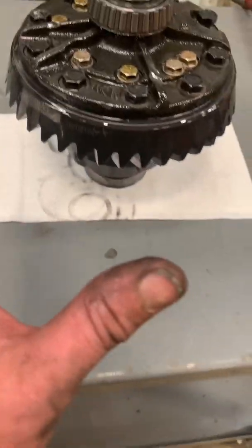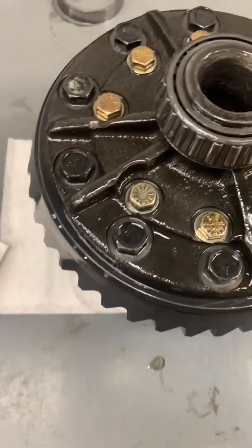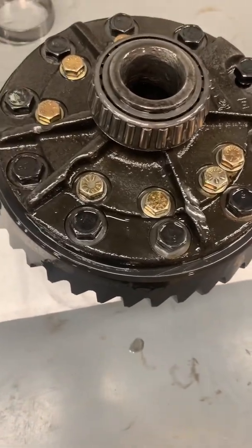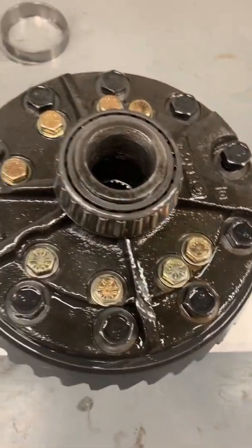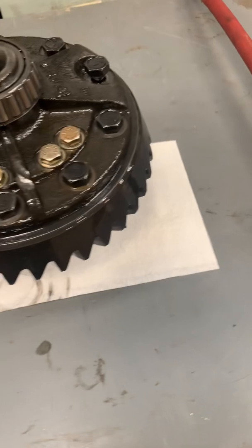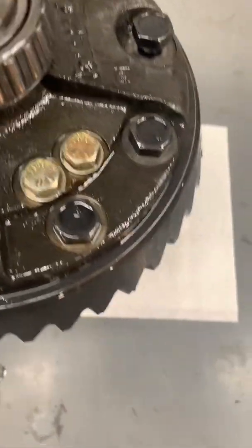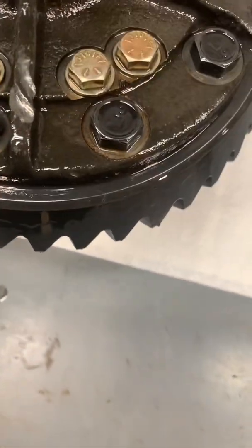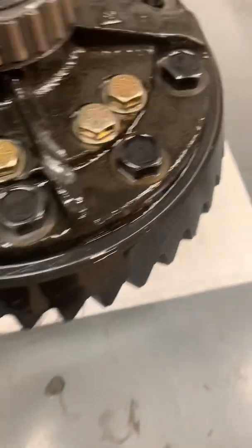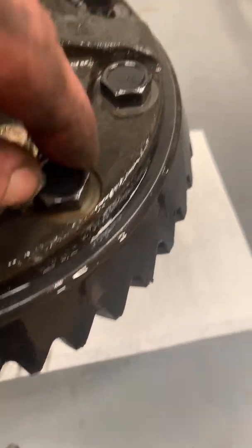The car is back down on the ground. Since I have rear disc brakes I can put the car on the ground with the wheels on the disc brakes holding the axles in place. I also have the side adjusters inside the axle guiding the axle shafts so they're not flopping around and destroying my bearings. The car is just getting pushed out of the shop. When you take the initiative and think maybe I should stop driving, you see things like this - that's not supposed to be loose, or that one.